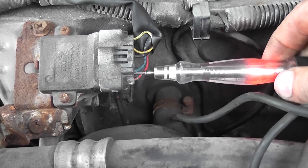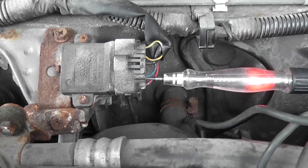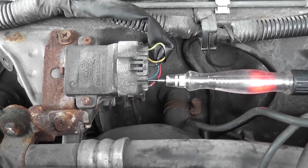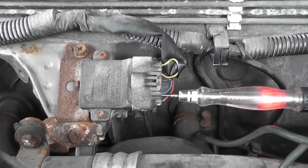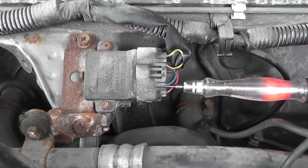What we've addressed is that we have a good harness between the coil and the igniter. I'm going to go up to the blue wire now — same thing, you want your test light to light and crank it. No control, no flicker again. The wiring integrity between the igniter and the coil is confirmed good.